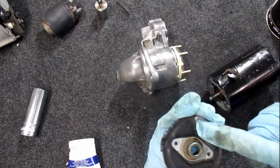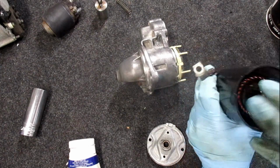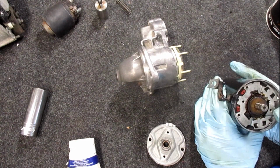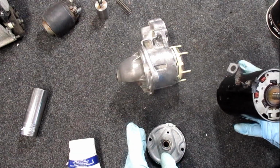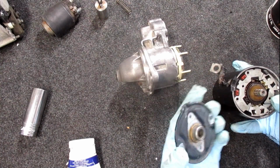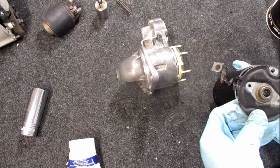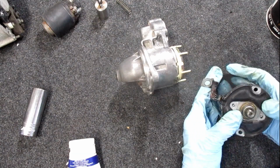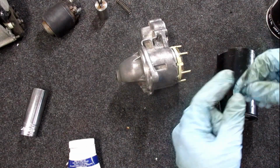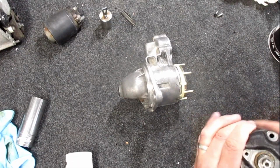the holes here for the screws. And make sure you keep your finger on this. I mean, the magnets are going to hold it, but just to make sure it doesn't fall out again. So it looks like they're going to go through these two big holes here. And we also can see that this retaining plate here goes down and holds that bushing in. Just like that. Now we need our washer and the retaining clip. Alright, there we go.